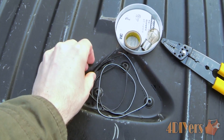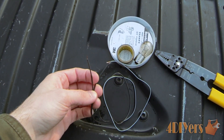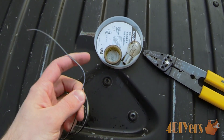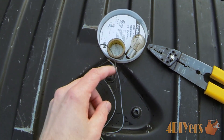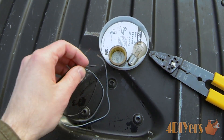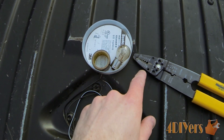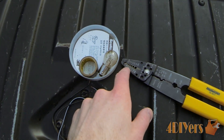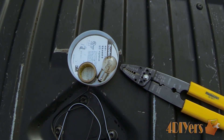Starting with the wire: since this was a pair of strands molded together, I started splitting the strands. The shorter end will go toward the bulb section and the longer portion will be used for the testing side. I stripped the wires on each end using wire strippers — for this gauge of wire I used the 22 to 20 gauge cutter.